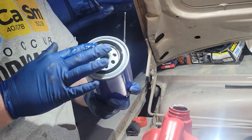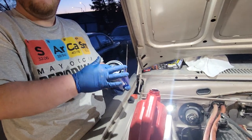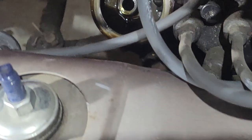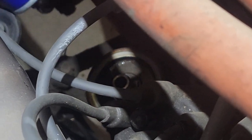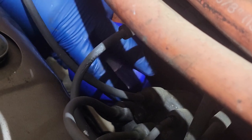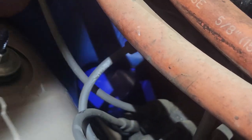We're gonna take our oil on our finger and make sure we have a good wet seal on that gasket — and I do a little bit on the threads too. Then we're going to come down here. That's where you're taking this — you're going to take it to the side of the spark plug here. You can't pre-fill this one since it's upside down; it goes straight down. This one's also right next to your distributor, in case you're ever wondering.